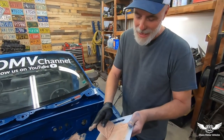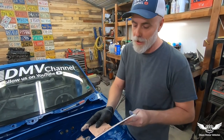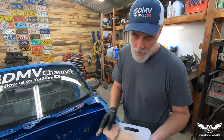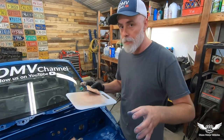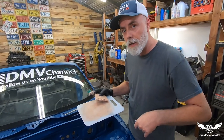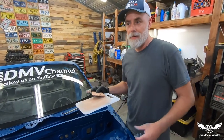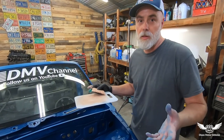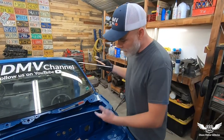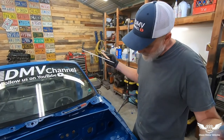Okay, well that didn't turn out very good. I've never actually finger troweled with a glove on. I have finger troweled a lot of weld — you can do it on roll bars, bumpers, or something where you want it to look good. You put the weld down, then finger trowel some body filler in it, sand it up and make it look like it's factory formed or TIG welded. Never done it with a glove on. This didn't turn out that great, but once we sand it it's going to look fine.